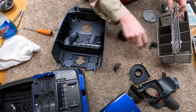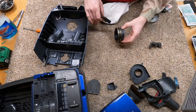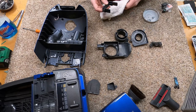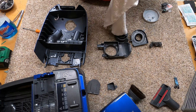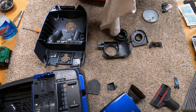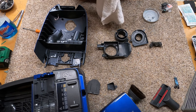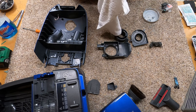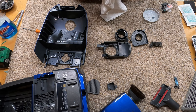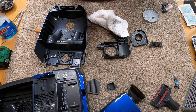Now with these direct-connect clutches on this series of machine, there are a couple of things you want to do. They need grease on them, but there'll be grease all over the electrical contacts, so you've got to make sure you clean those up and keep them dirt-free — if there's anything in there, it's not going to make very good contact. In this design there are two contacts on the rotating part, so there was a lot of attempt made so that even if one was blocked, it would still work. This part went in the dishwasher — it was much worse before. I like to slightly bend the fingers in again so that they're making great contact.